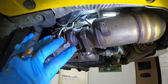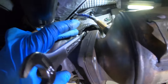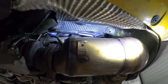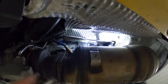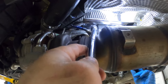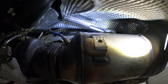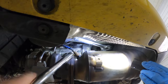Quick progress update. On the driver's side, I removed all the nuts and backed out all the studs — the last one I'm backing out is here. Here's a pro tip to get that O2 sensor out on the driver's side: you get that O2 sensor tool, throw a wrench on it, and since you won't have leverage, you get one of these extensions and use it as leverage. You push it up and you'll be able to undo it.